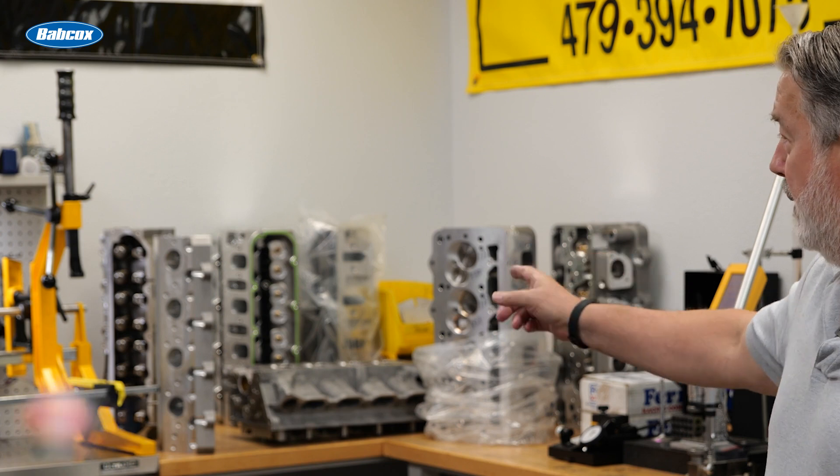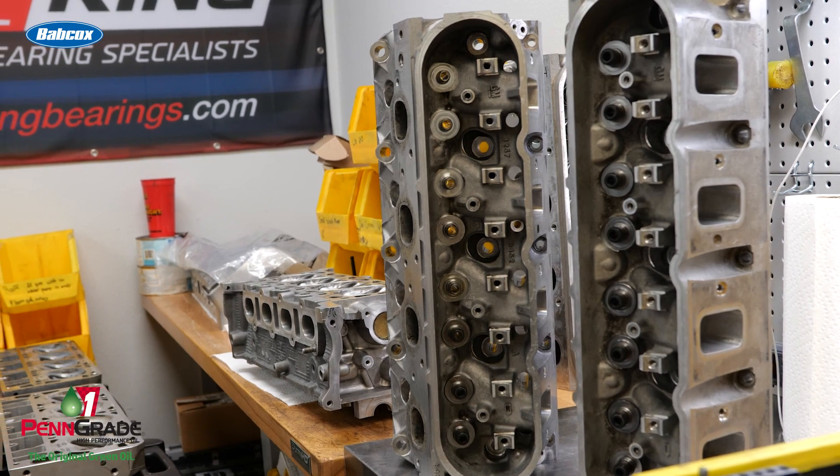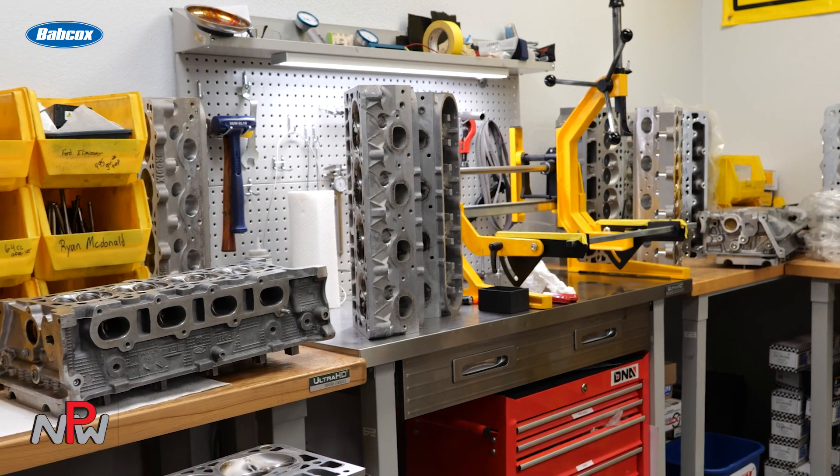It'll pull vacuum. The heads on here are CID LS7 solid roller heads with steel T&D rockers. They're basically LS7 heads, just bigger and badder. They have a port that Tony Bischoff and John at CID designed where the port is almost dead straight — there's no dogleg wall on the intake pushrod side. These particular ones were done by MBE. It's a small oval port. This will probably run on some kind of race gas, not alcohol. It'll have a big carb intake — one of John at CID's intakes — and a 4500 EFI drive-by-wire throttle body.